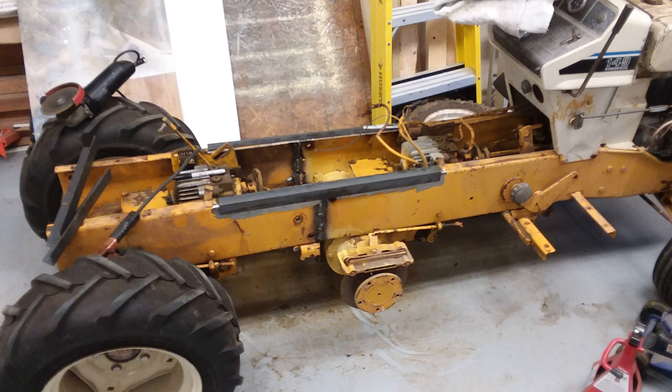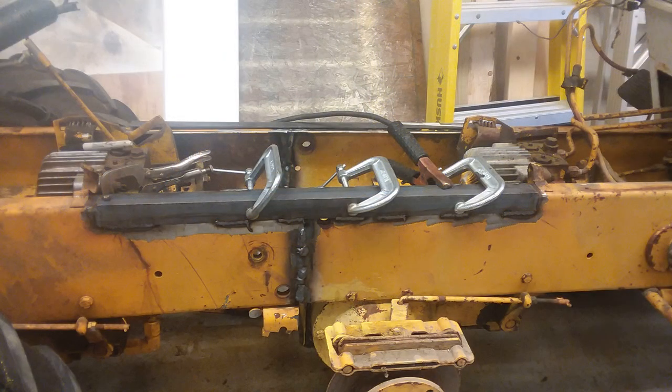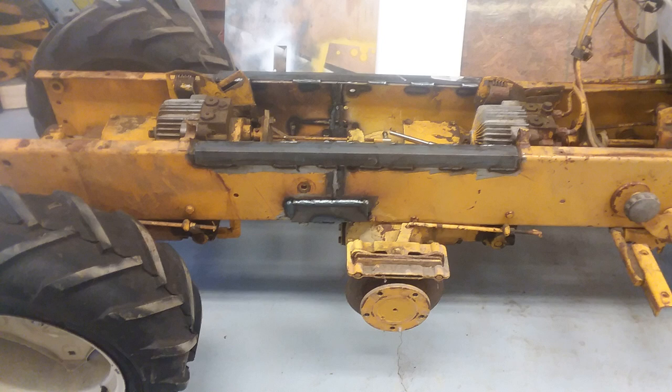I started welding the two frames together and welding the angle iron across the top for reinforcement. I got some questions about why I didn't do a zigzag or slanted cut. I didn't feel like the strength requirements warranted the complexity, and I was very close to the front axle so I didn't want to risk the attachment to that. I've also reinforced the lower part of the frame with a piece of plating that's been welded, which should provide a plenty strong connection for the two frames.